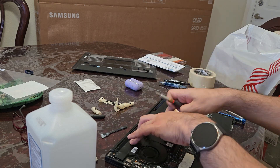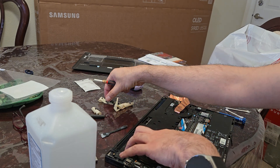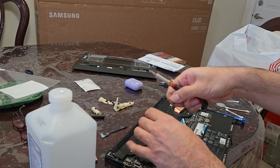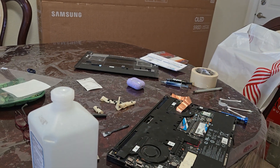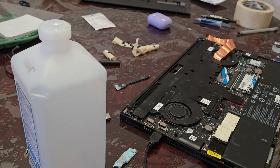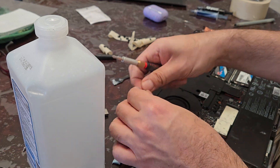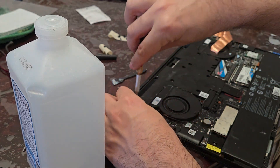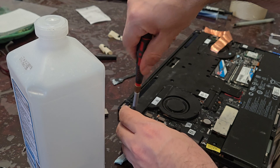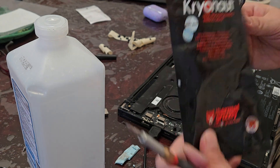First time we had a little issue with the GPU. The way we close this: first put the two corner screws on. You can look at the corners of the heatsink to align them. When you pick up the heatsink, be careful not to damage components or bend the heatsink. You need to use a kind of spatula — it comes with some versions of the thermal paste kit.